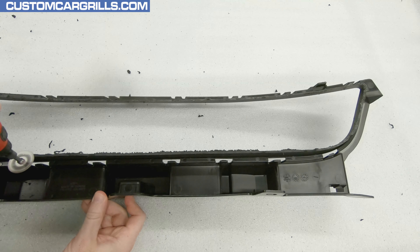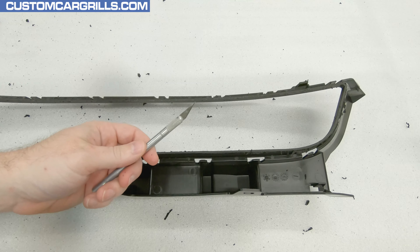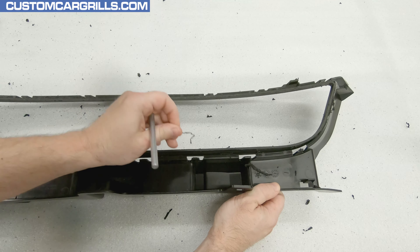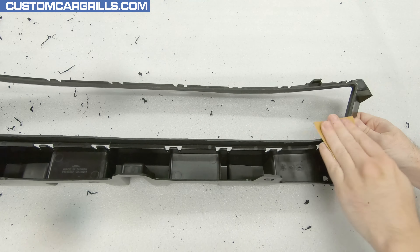I'm not digging deep — this is done with just very light pressure. Afterward, I'll pick off the burnt bits by hand again and then grab a sharp knife to trim back any small bits that may be left. I'm just gliding the blade against the plastic edge; I'm not trying to carve into this at all. For a finishing touch, some sandpaper might be a good idea to use on the edge. Depending on how smooth I want the edge, I can work this all the way down from a 180 grit to maybe a 400 grit. Here's a look at how my lower grille frame looks after cutting and refining it — it has a nice even consistent depth that will be a perfect housing for our mesh piece.